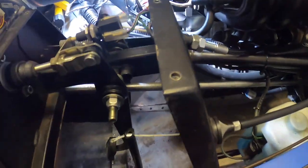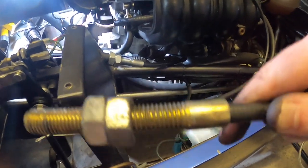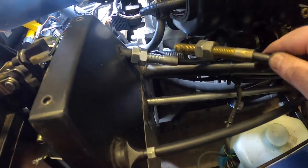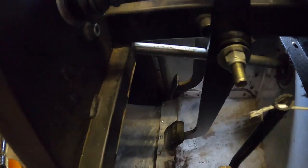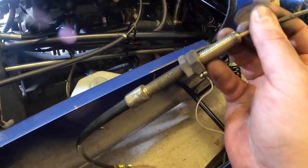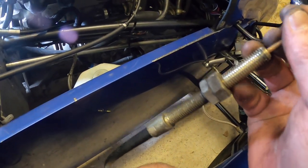To adjust the position of the pedal, I'm using the old cable as a guide. You can see that the locking nuts are about halfway along the threads, so I've just tried to roughly position my locking nuts halfway up the new thread. My pedal position is looking okay relative to my brake, but I haven't adjusted the gearbox/clutch end side yet — I'll go around and do that using the old cable as a guide as a starting point, then fine tune from there. I now have a clutch pedal and the clutch feels much smoother — it moves in one beautiful arc rather than snatching or grabbing. Hopefully this will help me drive the car more smoothly.